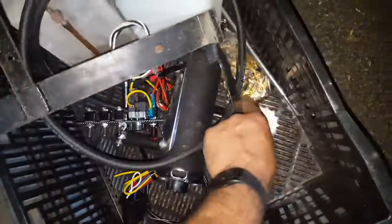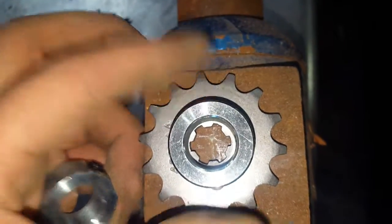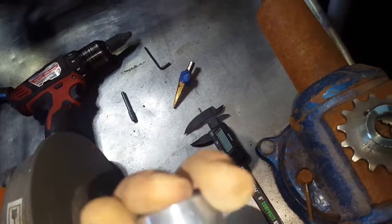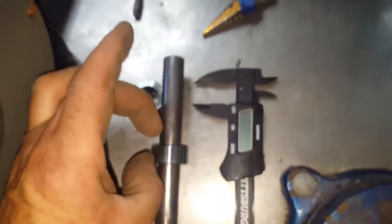Here's what the gear looks like — you have to get those bumps out of there to make it fit. Obviously you can see there's quite a difference. Once you do that and set it on the axle, you slide one collar on the axle, slide your sprocket on, then slide another collar on, pancaking them together.